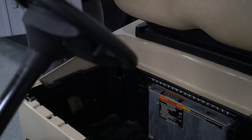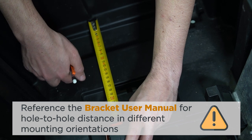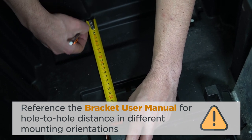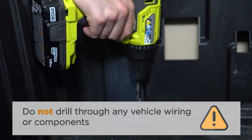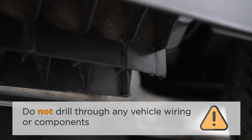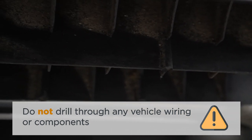Take out everything from the battery bucket. From the mark we just made, measure and mark the second hole. In this case, it's 195 millimeters from the first hole. Drill the two holes with a 10 millimeter drill bit. Also, check that you aren't drilling through plastic ribs in the battery bucket, which can be identified by the sink marks in the plastic.